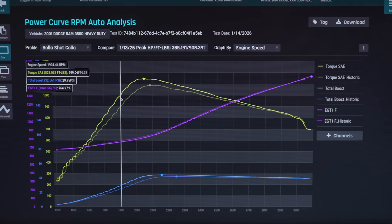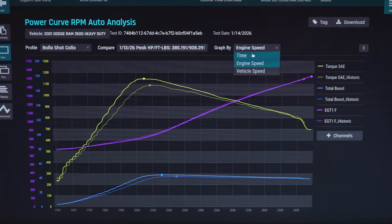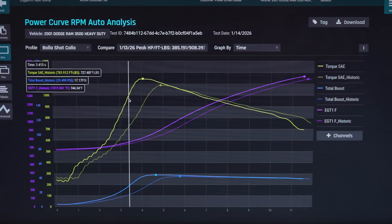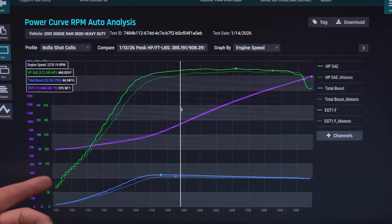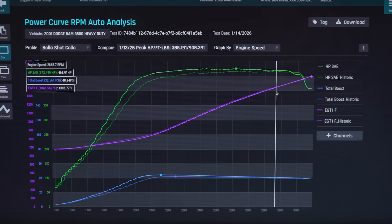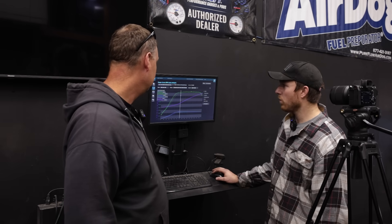Looking at the spool-up data: this thing hit about 1,000 foot-pounds of torque at 1,900 RPM versus before at 1,960 RPM — 60 RPM sooner. If you go by time, it's even better: 1,000 foot-pounds at 3.4 seconds versus 4.3 seconds, so 0.9 seconds faster to get into power. This is stuff you will feel as you're driving. You can say on a dyno sheet you only picked up 8 horsepower, but this truck will feel like you picked up way more because it's going to be responsive, the turbo's going to spool quicker. A big fan of the 4-inch exhaust — even though the peak number didn't really change all that much, it sure made it drive quicker and faster. Horsepower takes off, climbs faster, and stays higher the whole way through. Right here at 2,200 RPM, it's 464 versus 445 — that's 20 horsepower — just because of how fast that turbo can get moving.